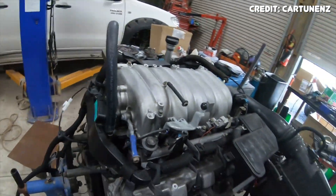The 3UZ is a double-edged sword, because although it's a lot like the 1UZ, the big downside is the increased bore size, which led to decreased cylinder liner thickness. Assuming you're not making a crazy amount of power, the stock cylinder liners on the 3UZ are fine, but if you're pushing above 500 or 600 horsepower, the stock cylinder liners on the 3UZ are going to fail much sooner than they would on the 1UZ, where they're a bit thicker.